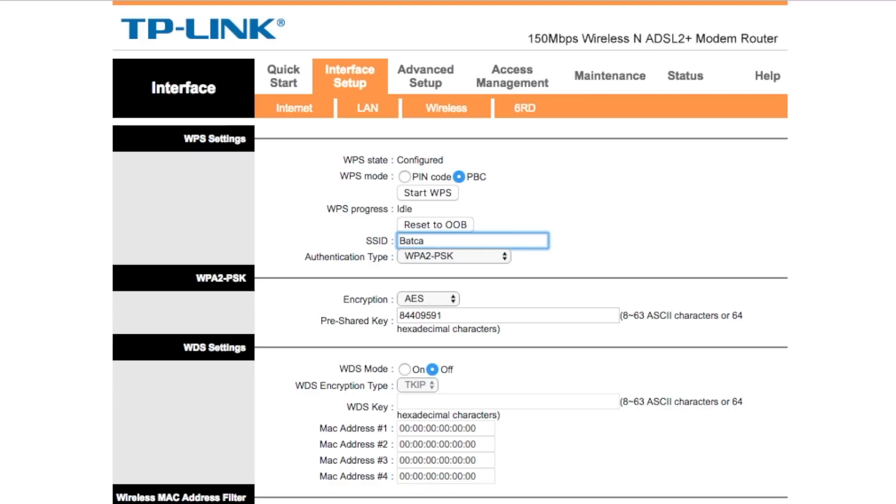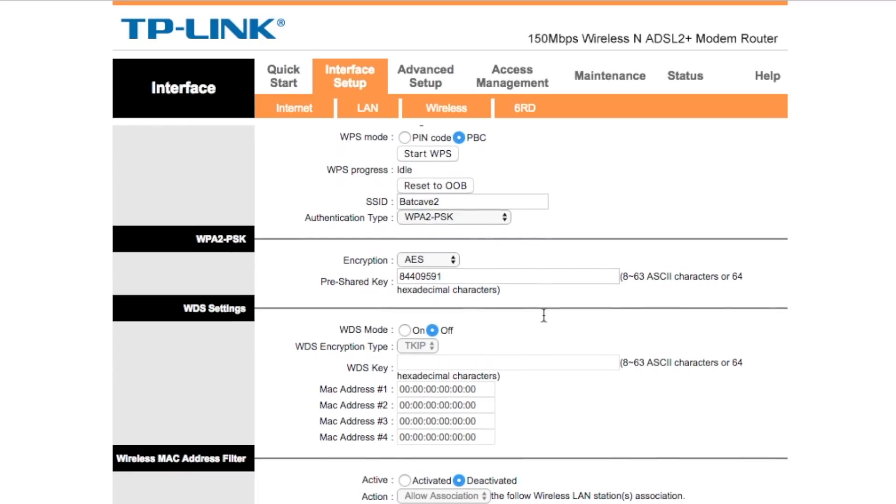In general, it's recommended to keep the same wifi name. The reason is that if two access points share the same SSID and encryption settings, they're saved as one wifi connection, making it easier for your smartphone to automatically connect to the stronger signal as you move around the house. Type in the same mode, password, and encryption that you copied in Step 1.